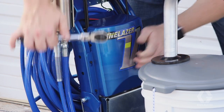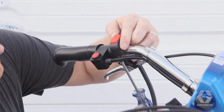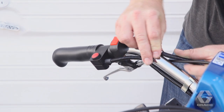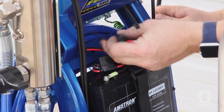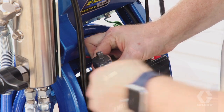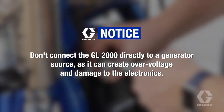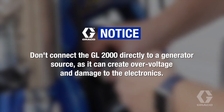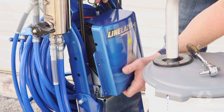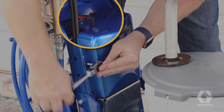Start by removing the battery cover. Attach the on-off switch to the desired location on the handlebar. Route the wires up to the battery and connect the positive and negative terminals. Don't connect the GL2000 directly to a generator source as it can create over voltage and damage to the electronics. Reattach the battery cover and be sure to keep the laser switch leads accessible.